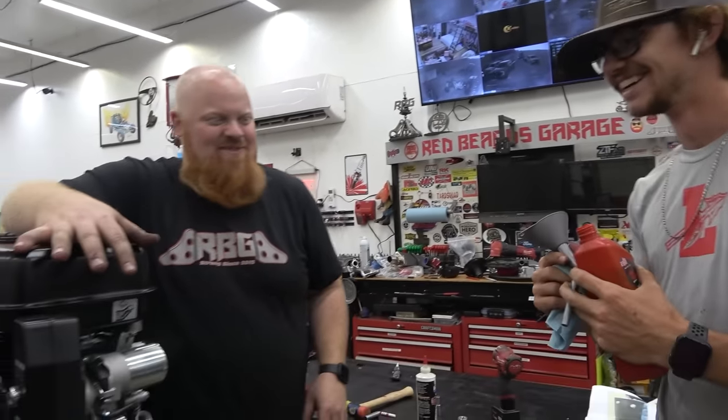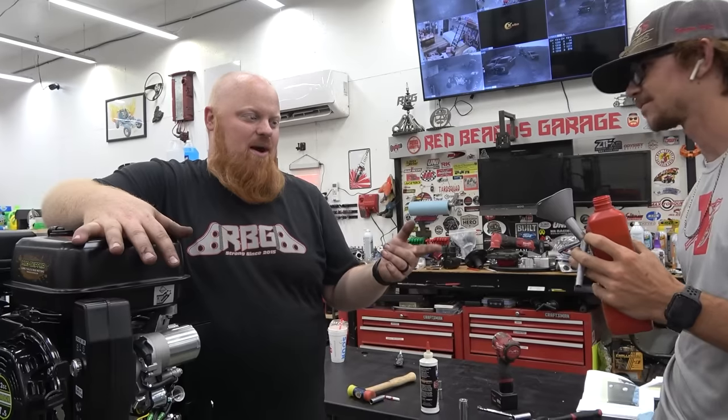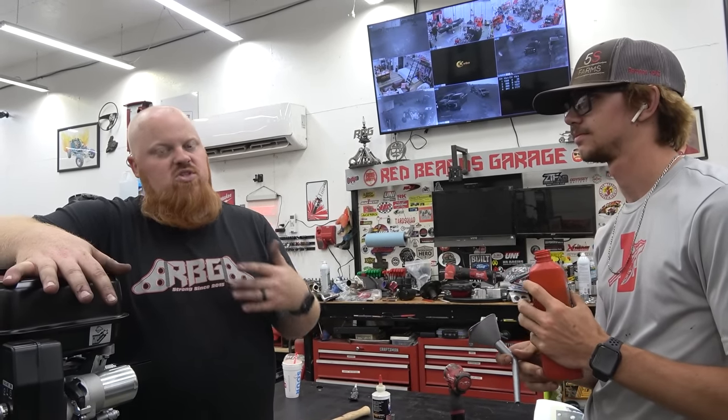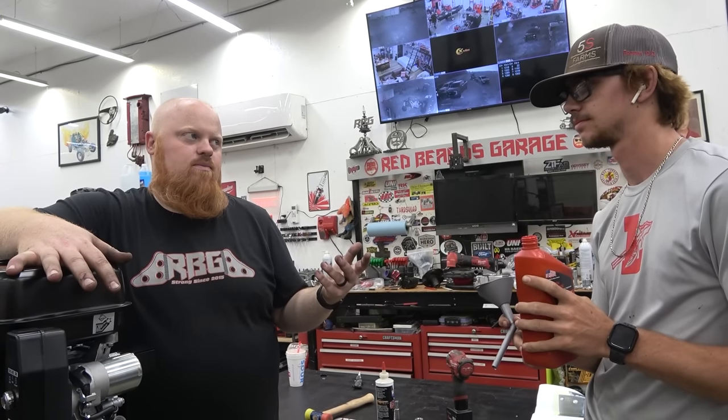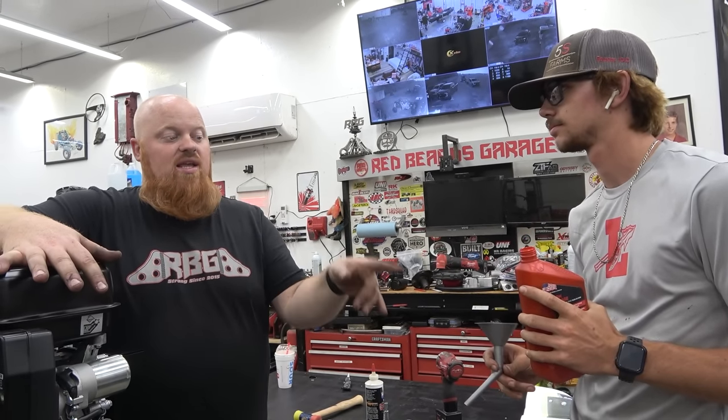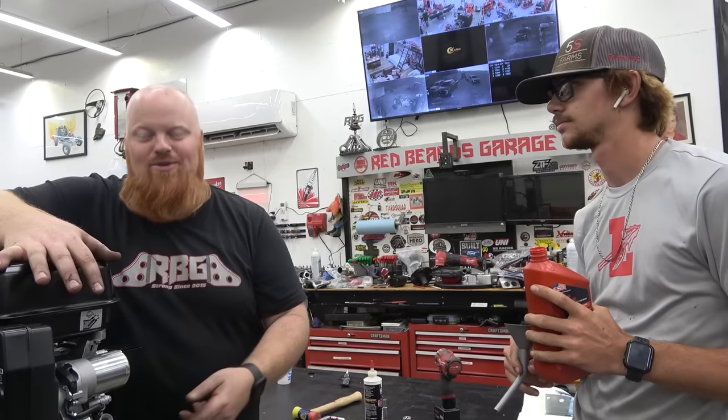And then he went to the dollar store to get oil. You told me to. And so he got 10W-30 high mileage synthetic blend, but this is a break-in oil. This oil should be changed after, like, I would change it in less than 8 hours because you're going to have another half quart. And that's the best thing. He can keep this half quart in there when he's at the lake, if he wants to change the oil.